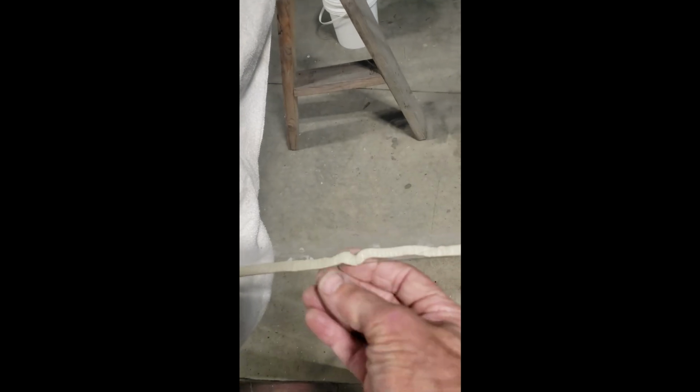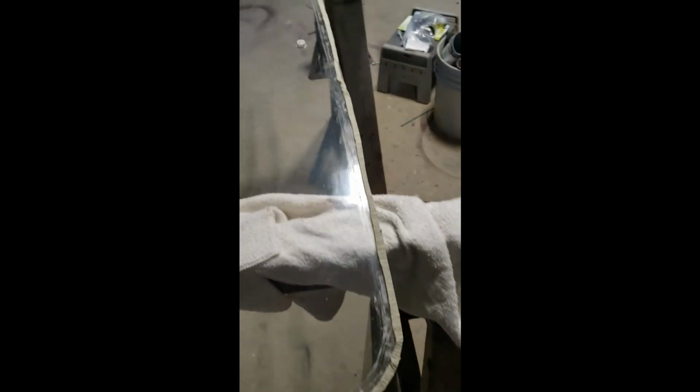I finished polishing the inside surfaces of both windows. Now they go together. So now I'm going to try this caulking tape. I've cut it roughly 1/4 of an inch all the way around. Then I'll squeeze the two together, see if I can get some kind of even surface out of this. Just make sure everything fits properly first, and then see how it looks at the end. Some of this is going to squeeze out awkwardly, I know, but I'll try and straighten it out to get it as good as possible.